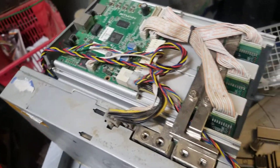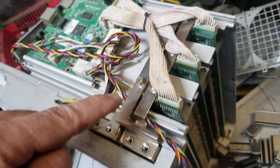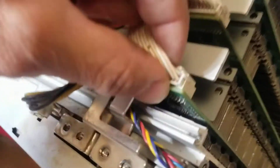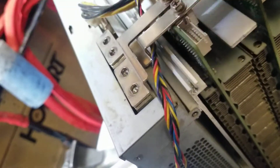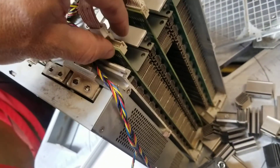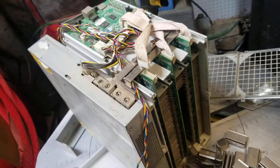This is how you get to the last piece to get your hash boards out. You've got two, four, and six screws here — pull those off. Wiggle these off; it's got a little clip in there, so wiggle that off really carefully so you don't break it. Wiggle those off and your hash board will normally just come right out.